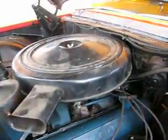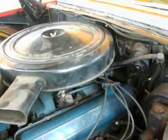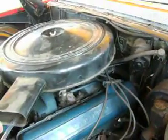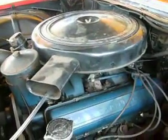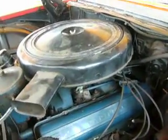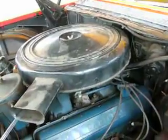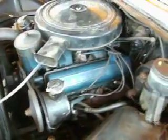I'm going to take the hose out and listen for the RPM drop. Did you hear that? I'll put the hose back in and listen to it rise. There's about a 50 to 100 RPM delta — there it dropped, and there it rises. It's definitely having an effect on combustion quality and soon we'll be posting results.